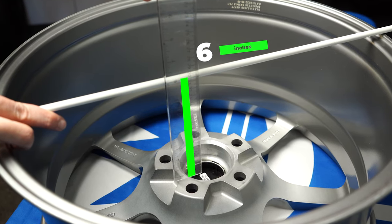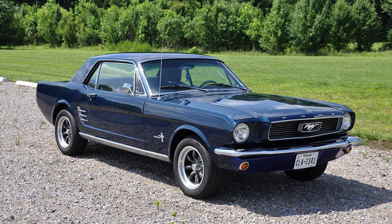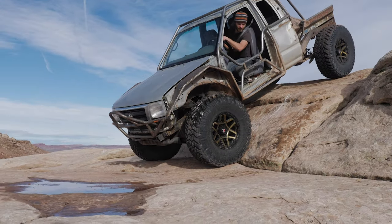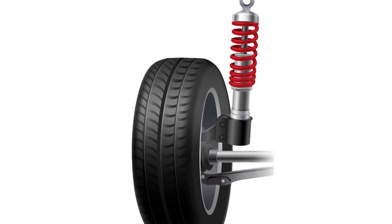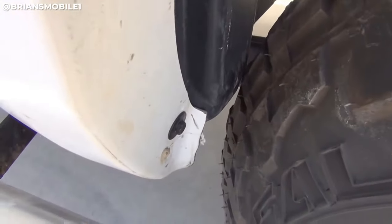It's a distance from the back of the wheel down to the mounting pad. The reason this term is more commonly used in American, domestic, and off-road vehicles is because they're more concerned with clearance from the back of the wheel inboard — toward the strut — making sure the wheel or tire package doesn't crash inboard, and when turning, that scrub radius doesn't contact suspension, bumpers, or rockers.